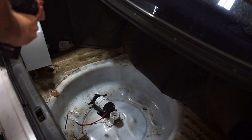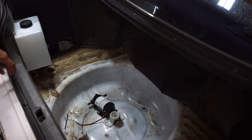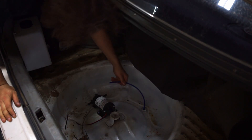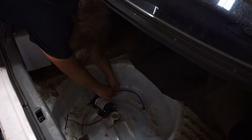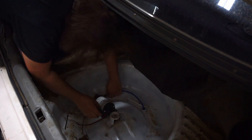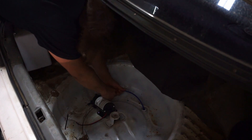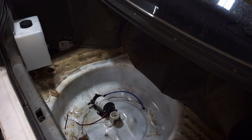Next I'm going to feed the nylon hosing from the back of the car to the front. I'm running it outside, under the car and near the brake and fuel lines — make sure it isn't kinked. Make sure it isn't rubbing on the ground or able to be hit by anything, because if you rub a hole through it and water-methanol is leaking out, that's a problem. The pump can make about 10 bar of pressure, so any leak there means your flow will not be the same anymore.